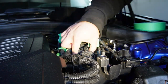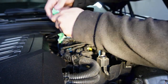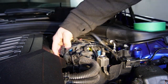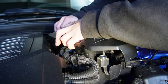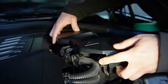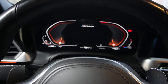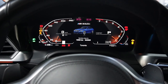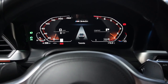At this point you can see the masking tape with numbers actually comes in clutch — I don't have to guess which harness goes into which terminal. After connecting everything, give it a light touch to make sure it's secured. Then put the cover back on — it's a bit of a struggle but eventually you'll get it. And this is the moment of truth: starting the car after reconnecting the battery. It starts. No check engine light. I think we are good to go.